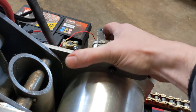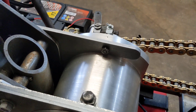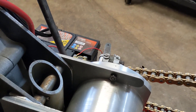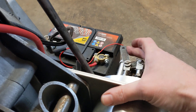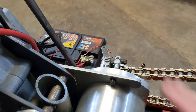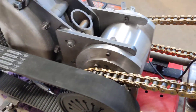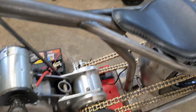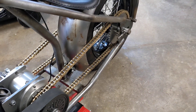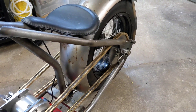It's much easier to do with two hands free, trust me. After a bit of effort, we're in top gear with the sprocket on the front. Now when I move the back wheel it will try to turn the engine, but I don't quite have the strength for that. What I can do is press the decompressor, energize the starter, and with the bike in gear and the back wheel off the ground we should see it all working — and there we go.